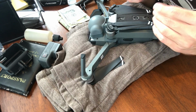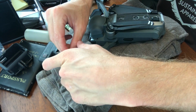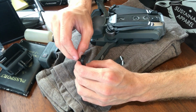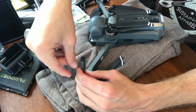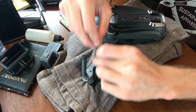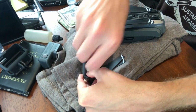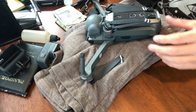And how I'm going to do this is like how you tighten a drum. Put all the screws in, giving them a good little hand tighten, but waiting to do the serious tightening until after all screws are placed. That way you distribute it evenly, and you don't have to worry about things being crooked and uneven.